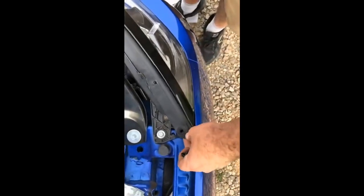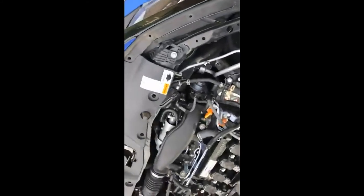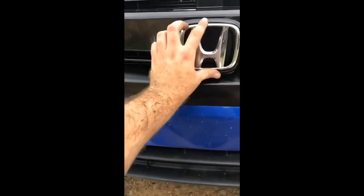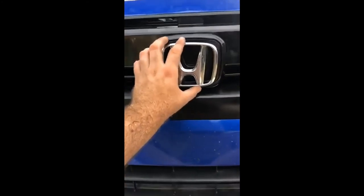On the outside edge of the rubber trim these are pretty easy. For the middle piece you want to pull it out halfway — that'll let you push it in there and then push it down flat. Do that to every single one of them. Notice the emblem doesn't want to go up against here because the holes won't line up, so you're going to have to take these knobs and cut them off flush, and definitely use some double-sided tape to put the emblem on.